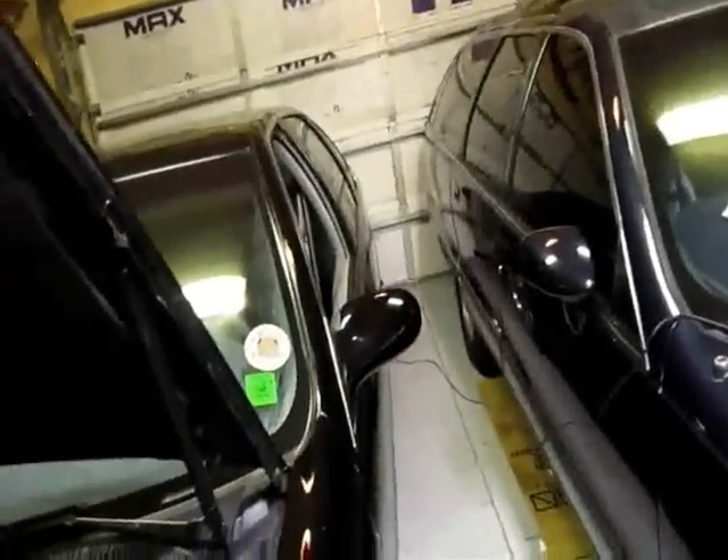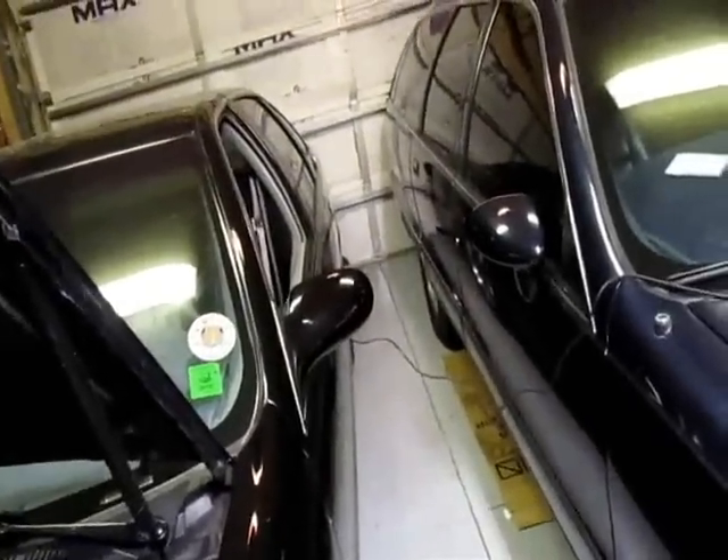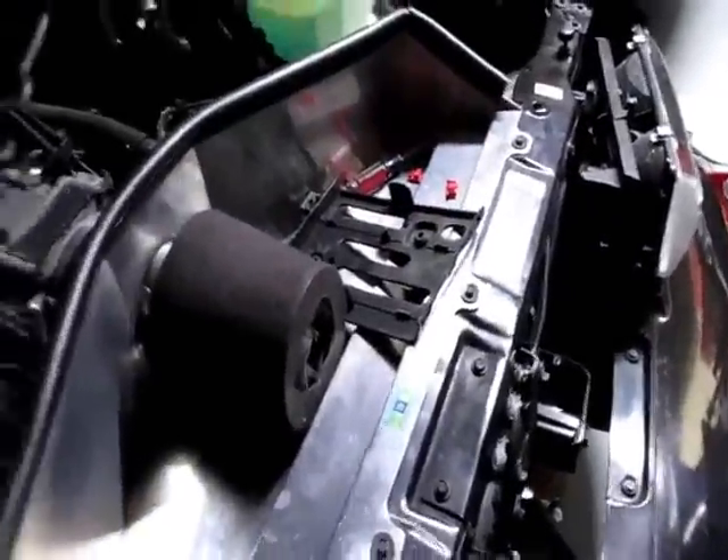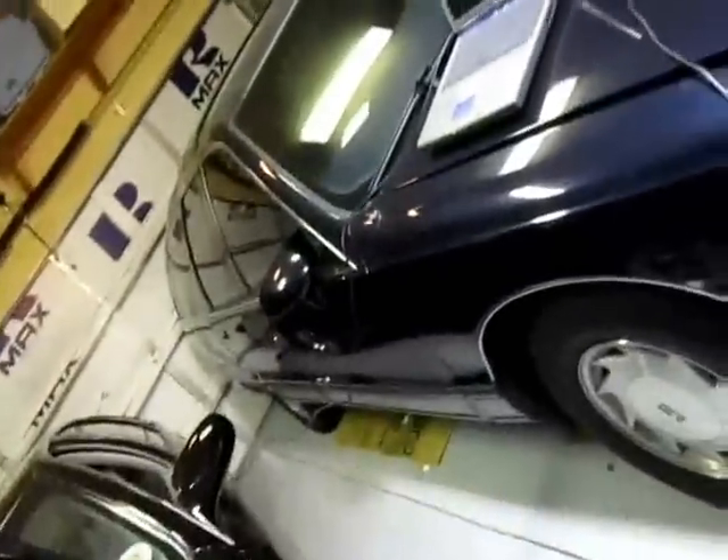I should put flash memory on this car. I can do it with the TBI — unsocket the chip — and then you can make this TBI computer flash memory. But I can't do it to the truck because it's a different PCM. The truck's weird — 94, 95 trucks had throttle body injection but they had the 4L60E. They controlled the transmission with it. This one has a 700R4 or 4L60 — not electronically controlled transmission. So it doesn't have that capability, like the 94-95 truck PCM does.